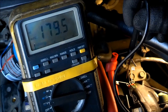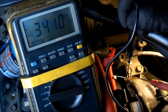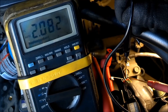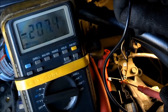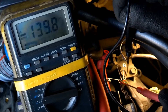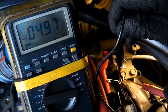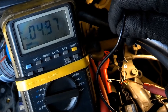On a normal battery you want 12.6 volts. Now on this middle signal wire, I'm going to touch here and we want 0.5 to 2 volts — and we are good, we got 2 volts. Now on this one, the 5-volt reference: I'm going to touch the ground wire and the reference signal wire and we got 5 volts. The negative sign means the polarity of the leads are reversed, so just swap them until the negative is gone — we got 4.9 volts. That's good. So far we got a good signal coming from the PCM.